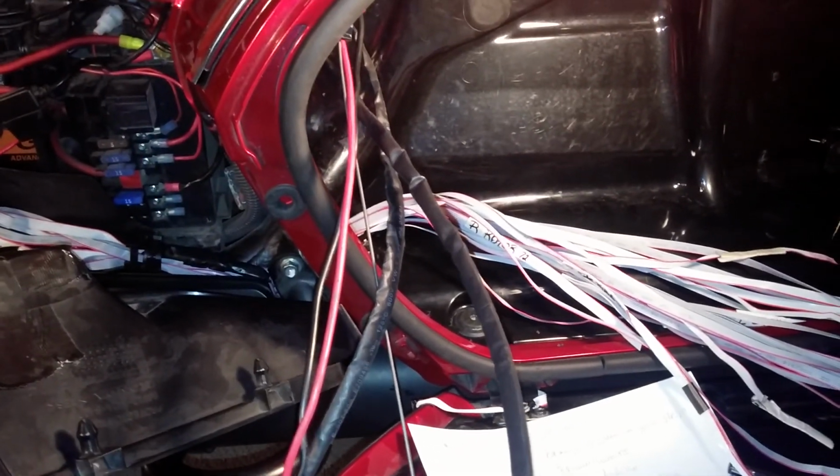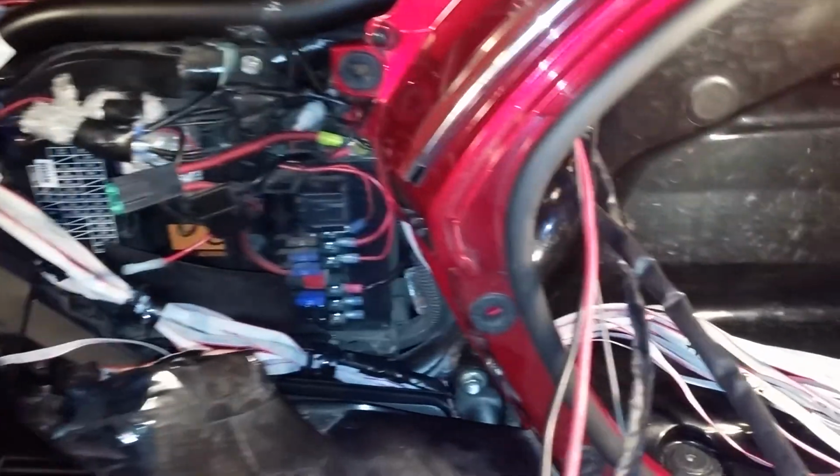But for me, because this is my third installation of the Rollin Eyes, and I have accumulated so many different Rollin Eyes light set leads, I'm at a point now that I almost need my whole left trunk. So what I ended up doing, I ran all my connections from my leads, which is all the gray flat cable that you see here, coming from the right side in the back, going across. I try to keep it as neat as possible, making all the connections, coming down the saddlebag, down the side behind the saddlebag, and all my connections come out at the bottom of the saddlebag. This is the flat ribbon cable that is connecting all my leads.